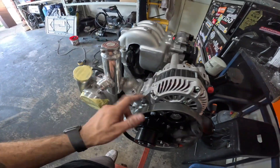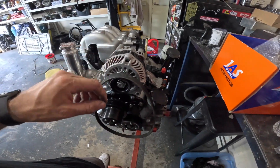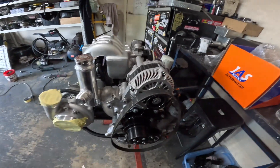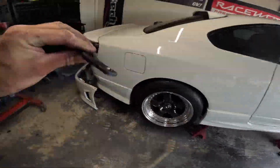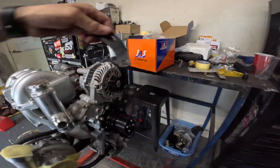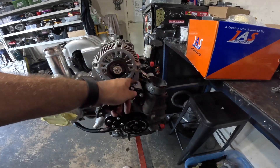Just have to measure up the belt once I get the tensioner sorted. We've got it on there — just need to get the right size bolt because it's an M10 hole. Should be easy enough, and for a whole five minutes of cutting, it didn't take a lot of work. Figured I can't leave you guys in the lurch like that — we can make a bracket real easy, let's do it. So I've got the stock one, cut it off, smoothed it around, drilled the hole. Obviously it still needs some paint, but we can deal with that later. That's going to suit the nut on it, so let's whip this nut off, get this on, find a bolt to suit, and hopefully it works.